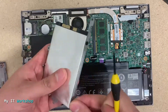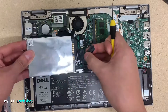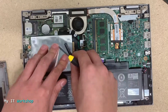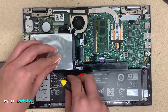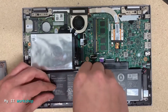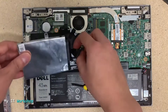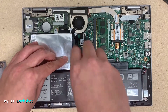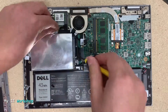As you may have noticed, in some places the video is sped up so you don't have to wait. I also made a second mistake — in the bottom right, that hole where the screw goes has to go under the plastic, but I had it on top. That's why when you run your hand over the battery and the hard drive they don't feel level; the hard drive feels higher than the other components and it's not going to close that way. Now I've done it right — the metal part is under the plastic and everything feels smooth. Be careful about that and don't make the same mistakes I made.